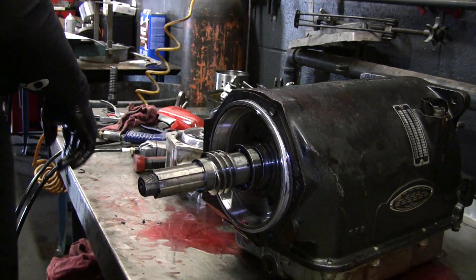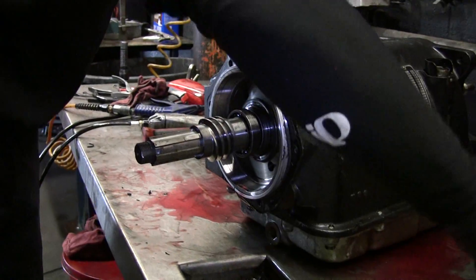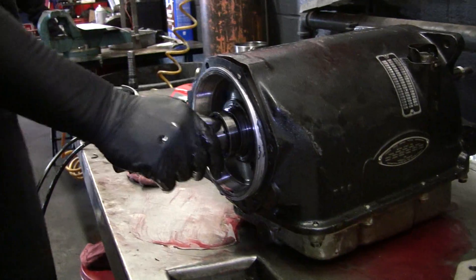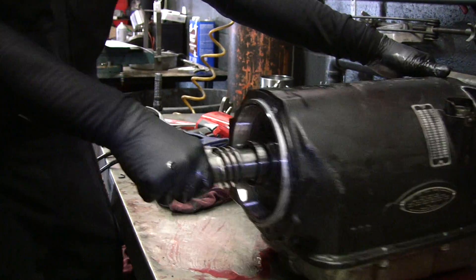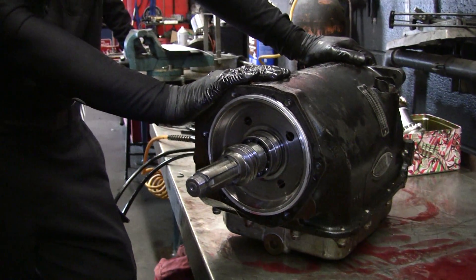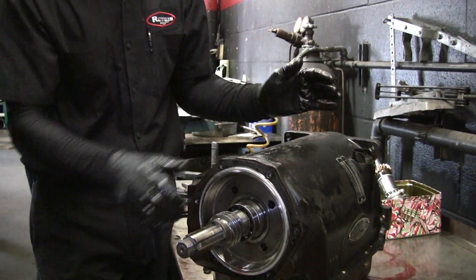When the car got warm after an hour or so and you put it in reverse, it would sometimes pop out of reverse. That is usually in the linkage, but we're going to address that. Those rings disturb me. So they didn't have the reverse gear within the gearbox? Oh, there's a gear in there — this just locks it up. We haven't got to the gears here. Instead of using a band to lock it, they use this thing — it uses a band and a cone, a reverse locking mechanism.